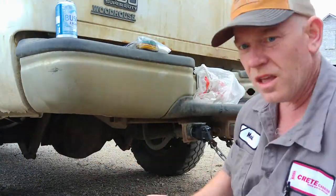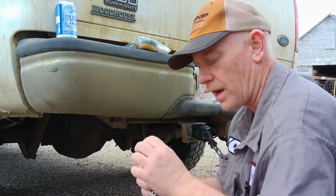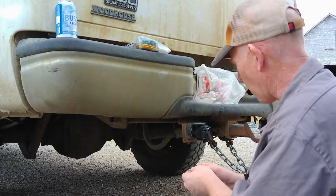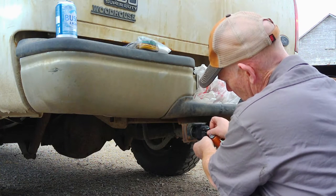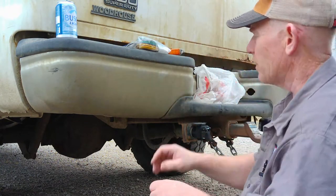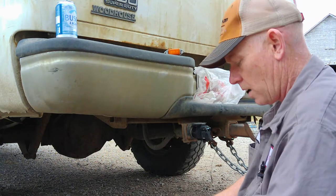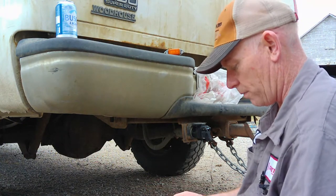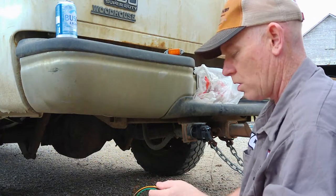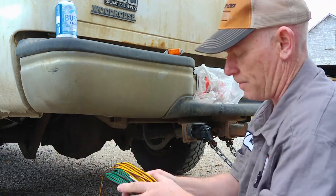So let's turn on the flashers. On an automotive application, your white wire is your ground wire, black wire is going to be the positive power wire. Down here the exposed terminal — that's going to be your ground. You touch your ground wire there and put it up in here. That one's working, that one's working — it's got left and right circuit. Now it should be yellow for left, green for right. Brown will be your clearance marker lights.